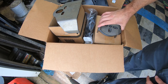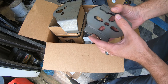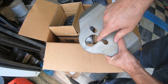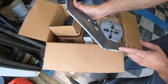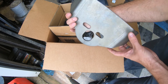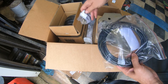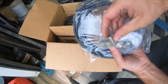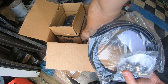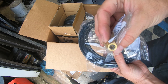Okay, these are Vixen Air products — helper springs. You get this little pad right here for the bottom, already curved to go around your rear axle. This is going to be the rear end pad. You also have this pad with a hole for your airline and hose for your bags. This right here matches the contour of my Ranger frame perfectly where it's got that little indentation, so that's going to be going on top and we'll be welding that directly. It also comes with all the provided airlines needed for the truck, the top section that screws into your airbag and clips into your airline.